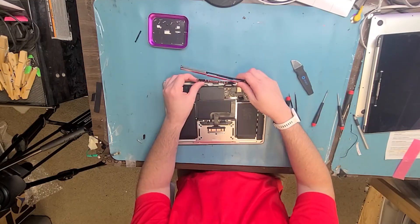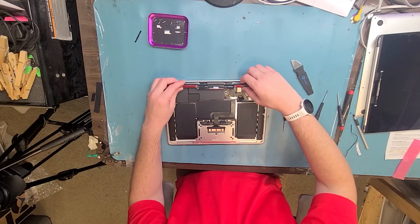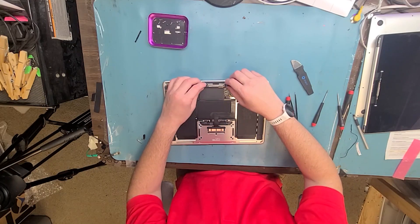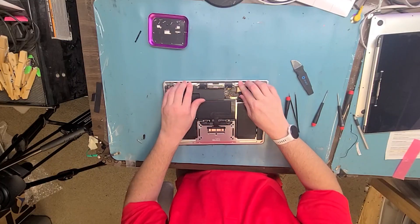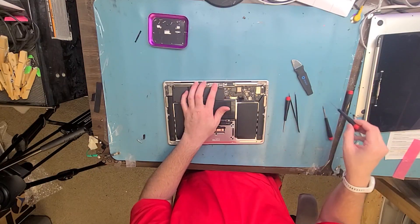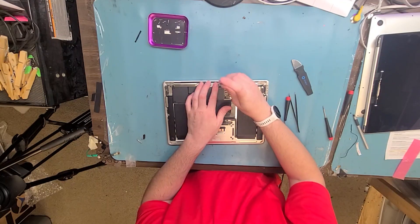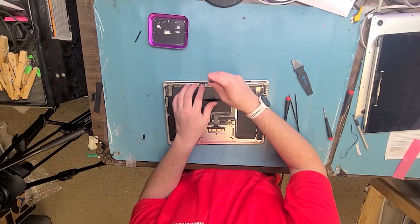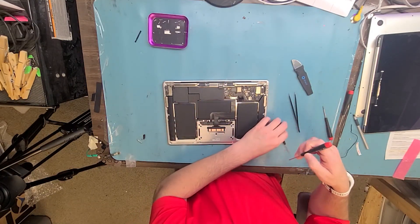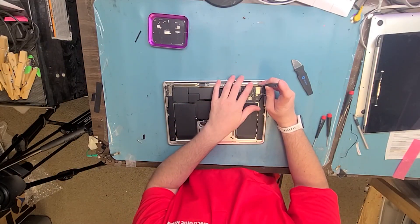You could connect the screen and just test it right away if you want, but I trust the screen will work so I'm just going to put it all the way back together. Take the Wi-Fi antenna and go through the LCD board through the hole, and line up the Wi-Fi antenna. Flip it in. Get the T5 screwdriver and get those two black screws, lay those down first. Lay the LCD board down and screw those two in. Then grab the long screws again and screw down the Wi-Fi antenna.